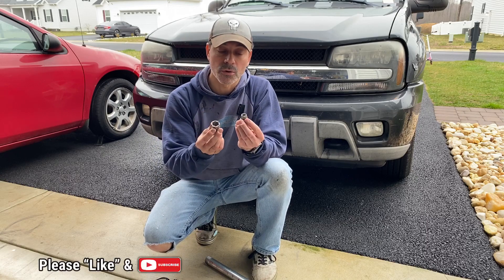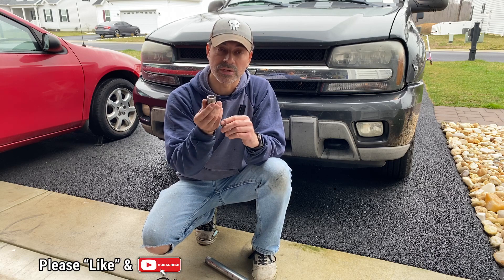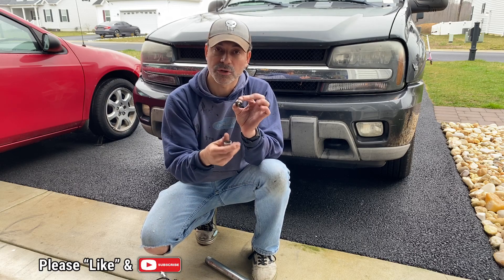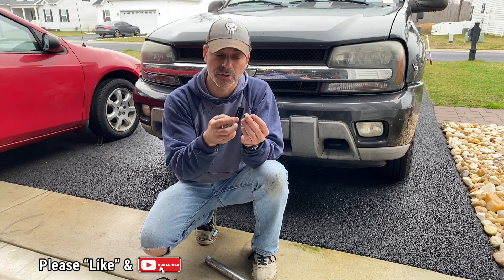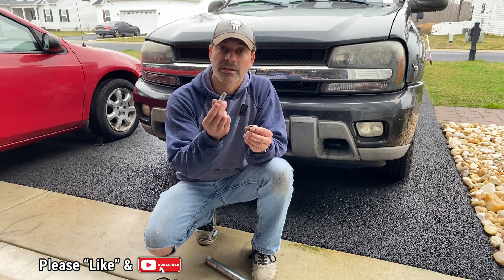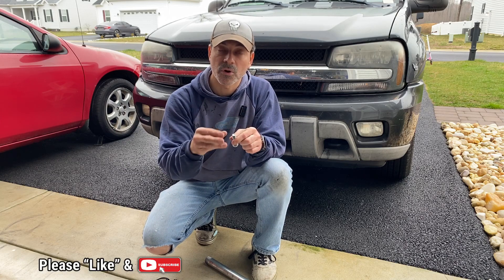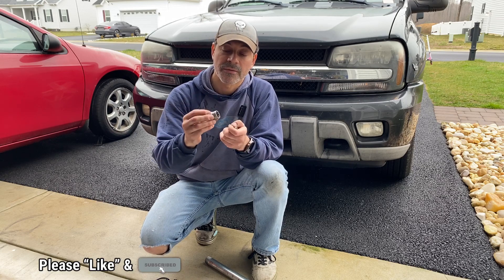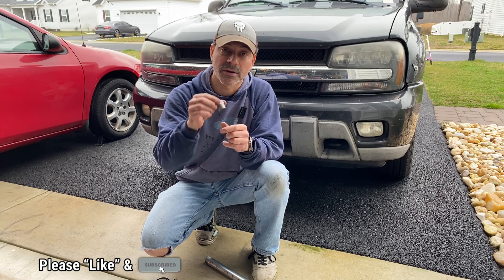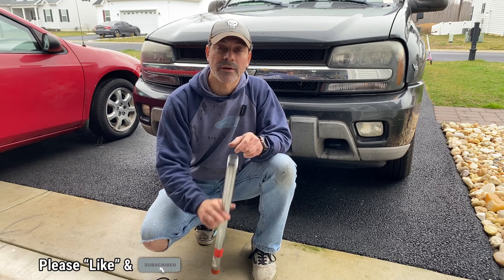That wraps up this quick video on how to remove a stripped lug nut — or any kind of nut — if it's lodged inside one of these bolt grip type sockets. With lug nuts specifically, you have a big enough diameter that you don't have anywhere to grab onto to knock it out. If you've got a smaller nut, sometimes you can get the punch in from the inside. But in this case, just take an extra wheel stud or a bolt at the right diameter, feed it in, and hit it on that flat part. Secure it inside a pipe so the hex pattern holds it on the outer part, give it a couple whacks, and it's done.